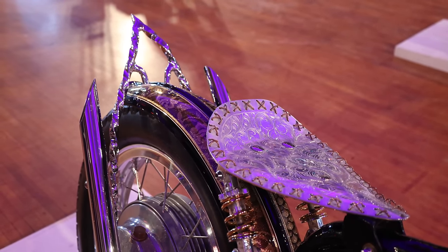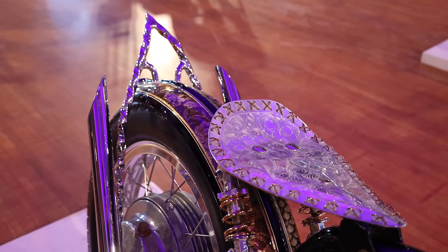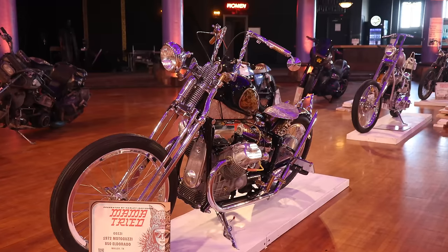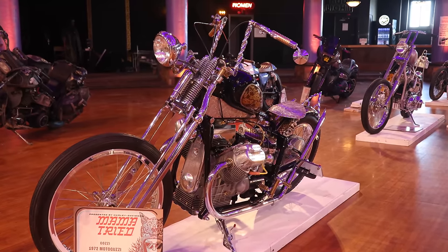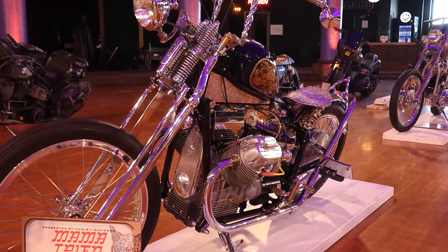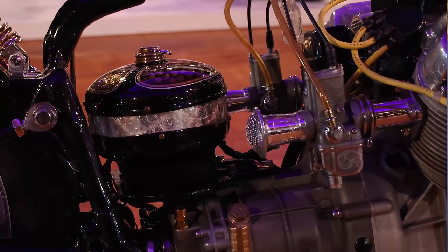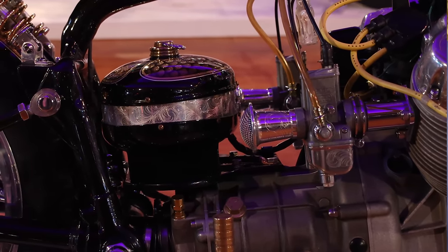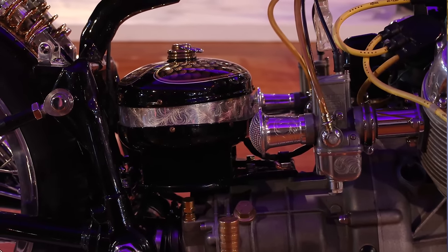I brought in a Wassel rear fender, a handmade aluminum seat, a peanut tank, a Springer front end, four over Springer, and a spool front wheel. I'm running the factory back wheel. It's still drive shaft. I redid the carburetor system. They crisscrossed in the middle of the bike. Now they're coming straight out, and I made them even. And where the original battery box was is now a cantina that I split apart and put all my electronics in.